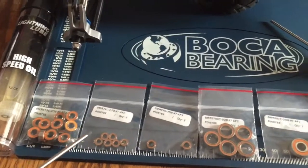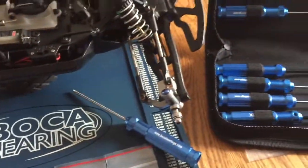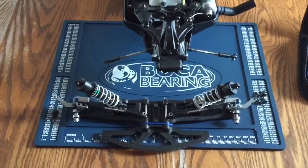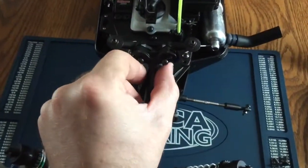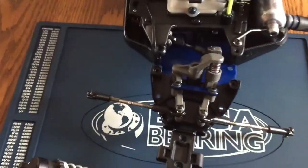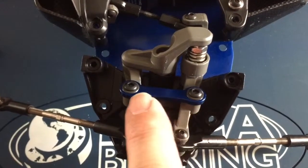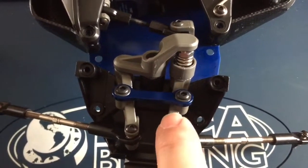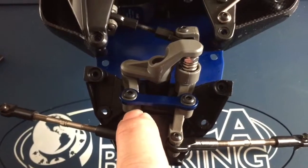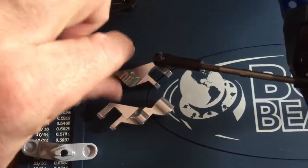Today I'll demonstrate step by step the replacement of the front suspension bearings. The front suspension has now been removed and I'll be taking the bell cranks out. As you can see, this exposes the bell crank system here — you'll notice the upgraded drag link. I'll be replacing these plastic bell cranks with new aluminum ones so that the new bearings have a nice home to sit in.